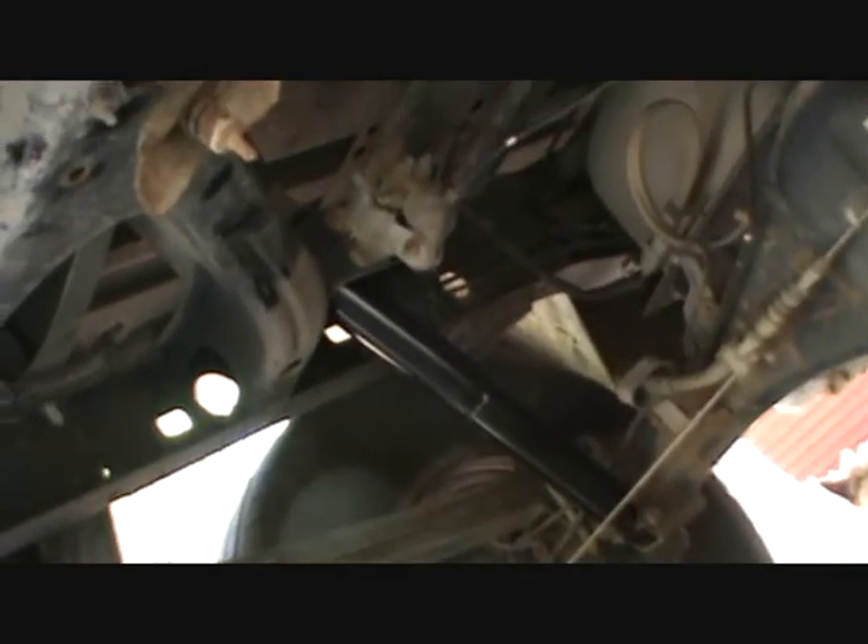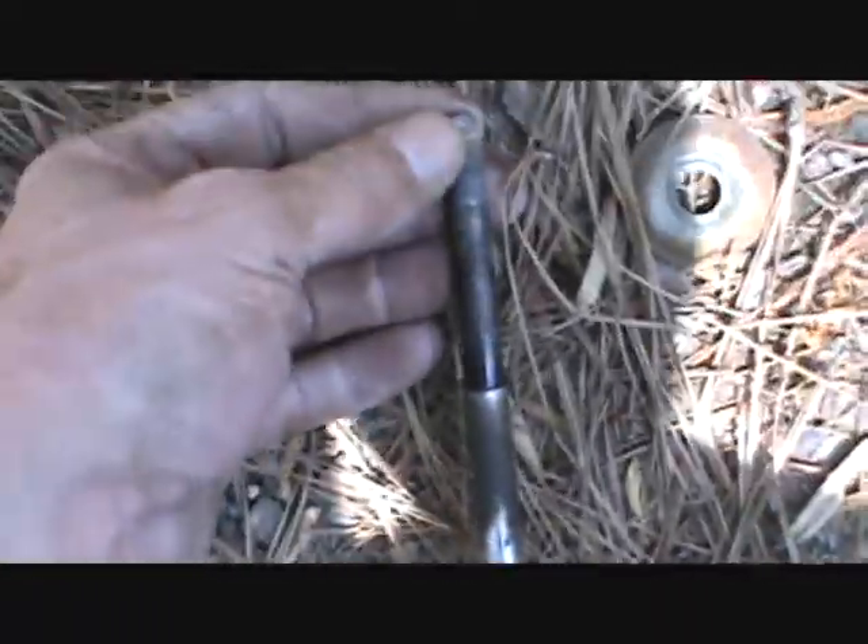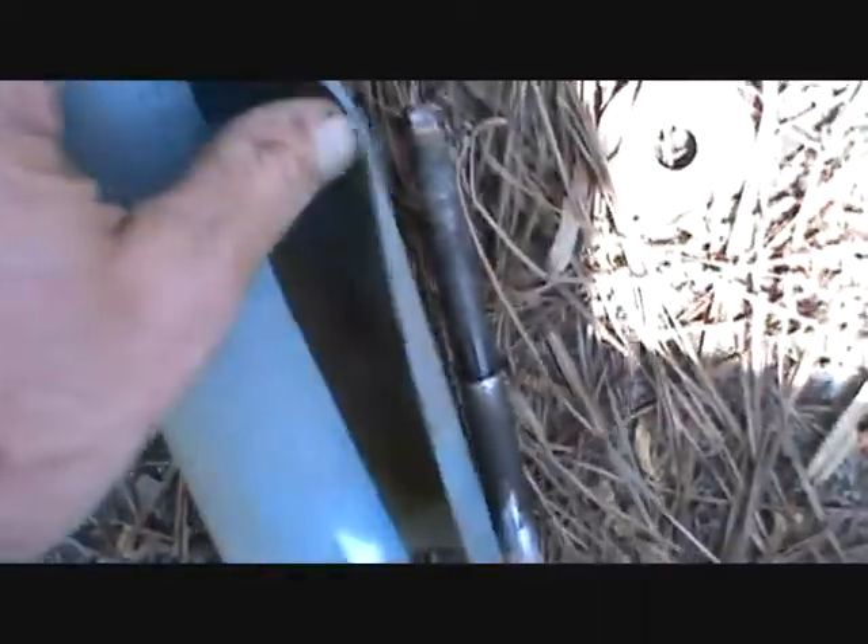Wow, that was really simple — job's done. One nut at the top, one bolt at the bottom, a 14 and a 17 millimeter, and you're done. It's easy. Mine weren't rusted too bad. To do the driver's side, go through where the spare tire is. Passenger side looks like easy access — just pop off the tire. The only big trick is when you're trying to take off that top nut it's gonna spin. There's a little flat on there for a wrench, but really the easiest way is to split the boot and put a vice grip on the shaft to hold it still.